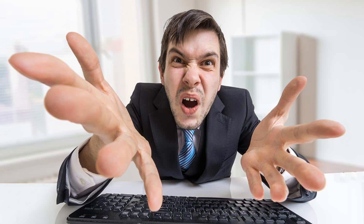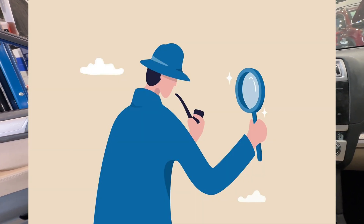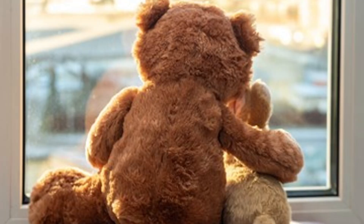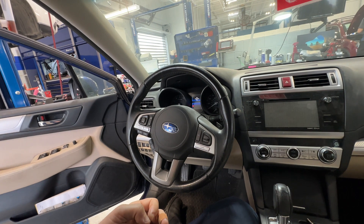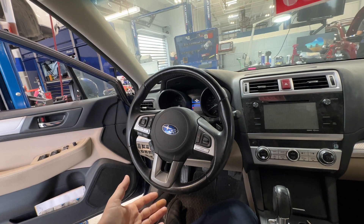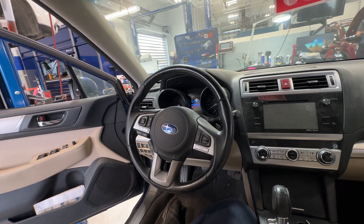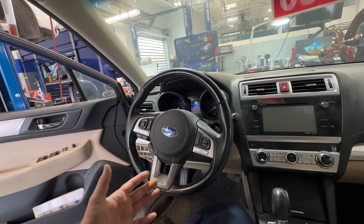I understand a customer can feel upset when they just got tires on and now they're told work needs to be redone. But right here is the evidence — this is what I did, this is what I collected, this is what I want to do. It makes them feel safer about the next steps. I'm going to recommend taking all four tires off to check road force and balance on each. They could have thrown a wheel weight, a tire might have excessive road force requiring the rim to be turned, or they could have a bent rim.